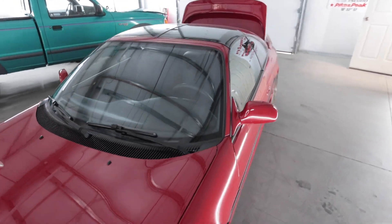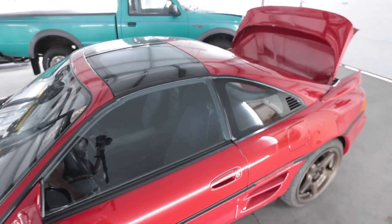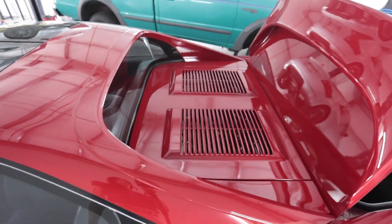Before I commit to pulling the cab and the bed off this Ranger and doing the full restoration on it, I want to get the MR2 sorted because I have sponsored parts for it. I'd like that car to be drivable so I could just hop in it and do a short road trip, but I don't feel confident in it right now because of the wiring. I need to redo the engine harness because this thing has a JDM engine and JDM engine harness in it, which means it came from a salty Pacific environment — which is why it has creepy green death on just the engine harness and none of the other harnesses.